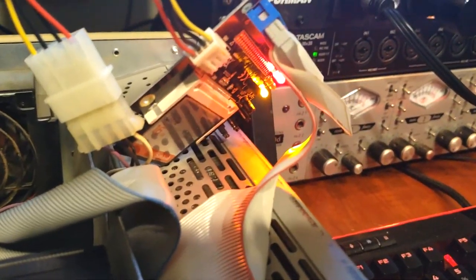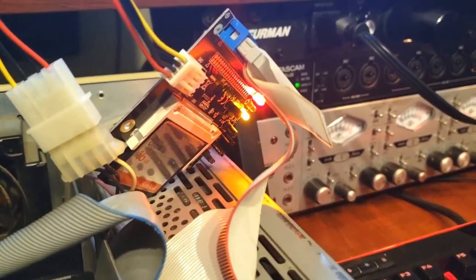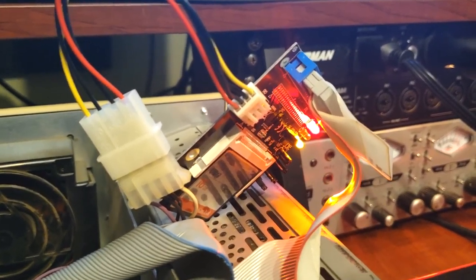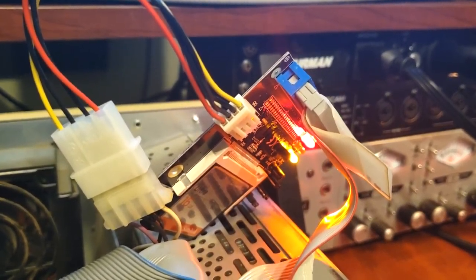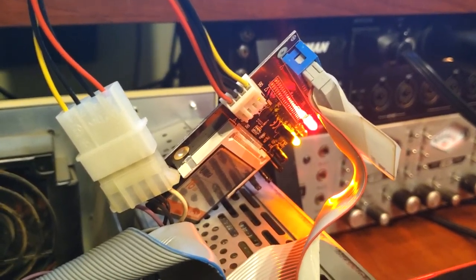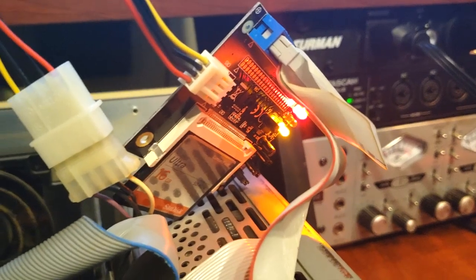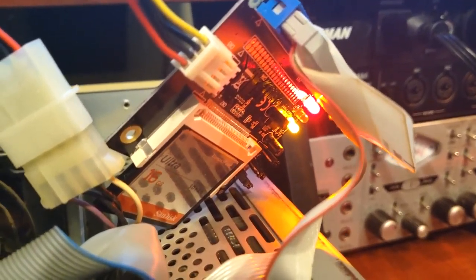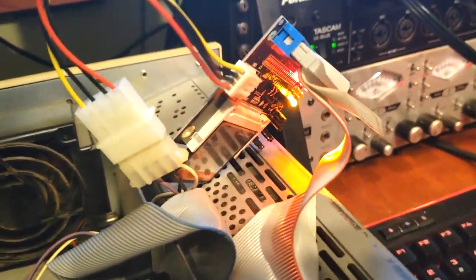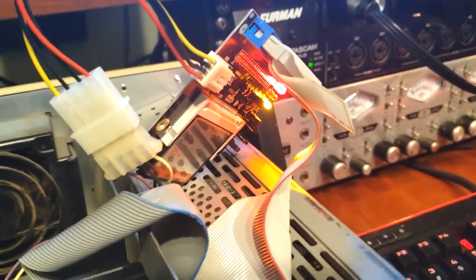I will just say, if anyone has a Compaq 286 out there, the fixed disk type, there's a bunch of different types. It's a number code, type 1 disk, type 2 disk, type 50 disk. I was able to make it work with type 33. So if that helps anybody out there, type 33 has worked for me on this Compaq 286E. Now that means that it's only a 112 megabyte partition, but it's working, so that's what I'm going with.